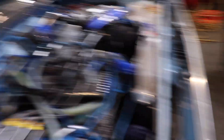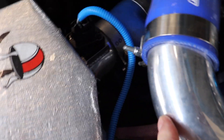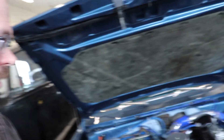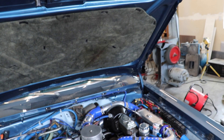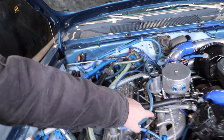There's another radiator tucked up on this side of the car, and that system is actually coming across the bottom of the car. Way down in there there's a line coming over to the intake manifold, then out from the intake manifold it comes across and back into the top of the radiator. That should about double our actual cooling capacity. They're also separate because the intake manifold is next to a high heat source, so it may have to work harder, whereas the intercooler sits farther away. The cooler I can get that air coming in, the less this system has to work.